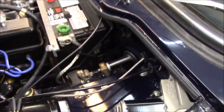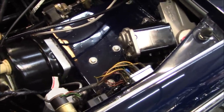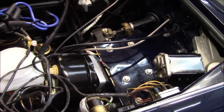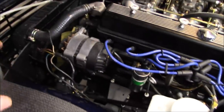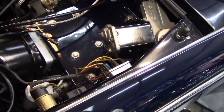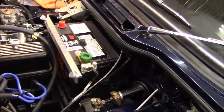We've got a bit of a head start on the wiring. We've got the relays and the fuse box hooked up along with some of the other ancillary items. We have the overdrive harness hooked up — it just needs to be run inside the passenger compartment under the dash and hooked up there. Some of the rest of the hookups we'll leave for when Alin comes. I'll probably do a little bit of rewiring back here, maybe put some new connectors — some of these don't look so good. We also put the kill switch on the battery, so that's ready to go.